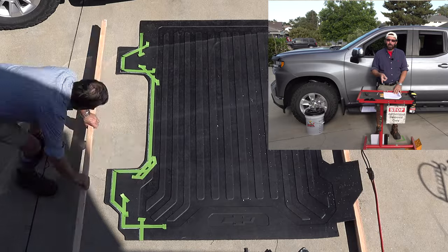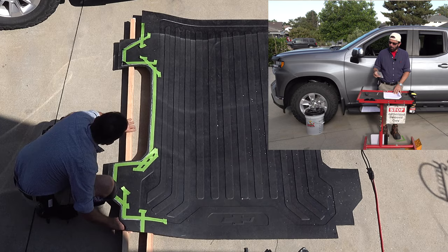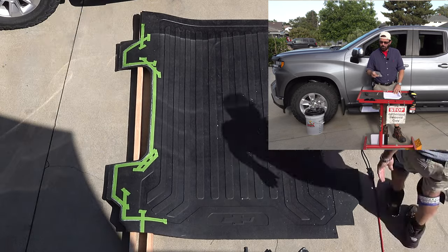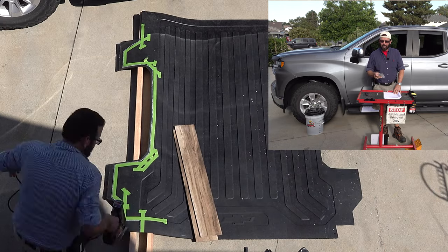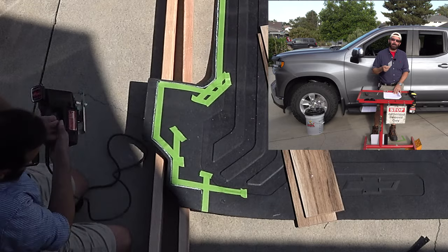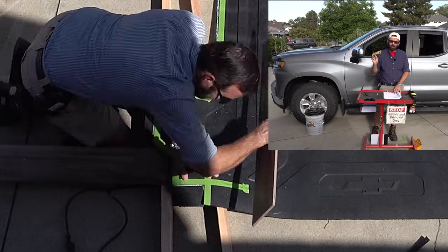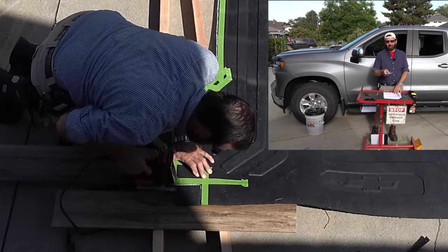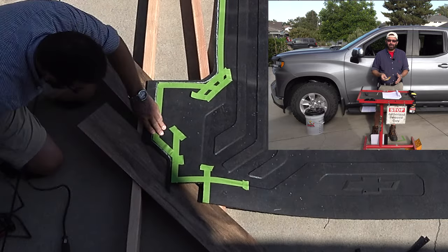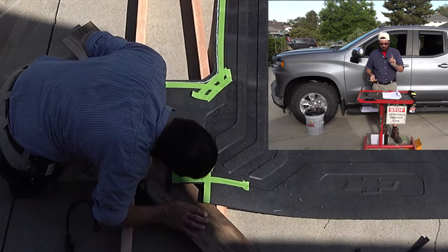Even though the cutting process was sped up, the DeWalt blade cut through the rubber with ease. The part number for the DeWalt blade is DW3774H-2. It's a 3-inch T-shank blade with 18 teeth per inch. You would think a blade with bigger teeth would cut through easier. No, you need finer teeth. And like I said earlier, make sure the gap on both sides of where you're going to be cutting is as tight as possible, and you'll get a nice straight cut on the first try.